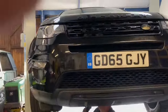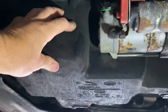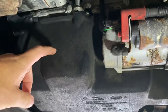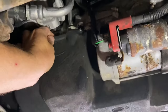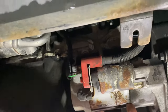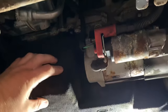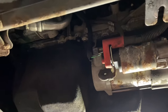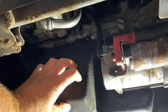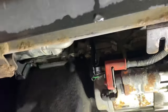That won't be too easy because the under tray came off covered in water that had been sitting in it. There's a sound deadening pad on the sump with loads of little trim clips holding it on. The starter motor is going to have to come off, and there's an engine mount at the back that has to come off as well because it bolts through the sump - you can't get to the bolts with it on.